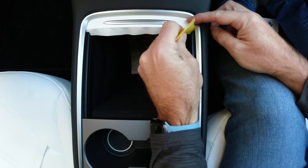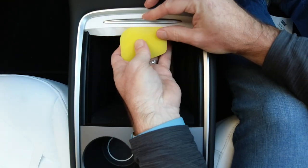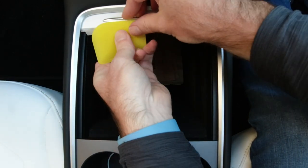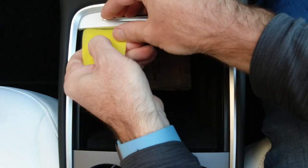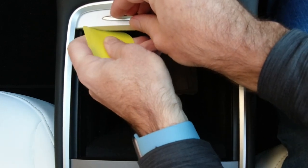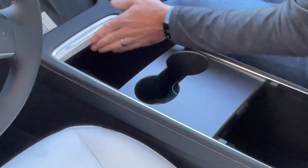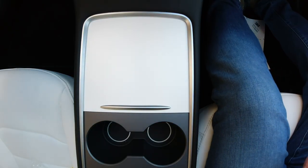Pay attention on these little corners too, because they're tucked in under where they slide on the rail. Get the straight edge of the squeegee and just work it down using pretty good pressure. If you have any persistent ripples on this edge, just grab a hairdryer and work them out. Hopefully you can see that's gone on perfectly — it doesn't stop the mechanism, it's nice and clear, and it really looks very factory when it's done because you don't see any of the edges at all. No one would know it didn't come from the factory in this color. Moving on to the second piece — the cup holder.